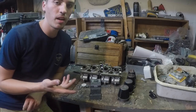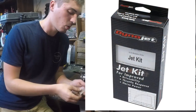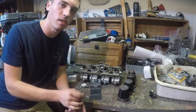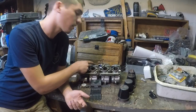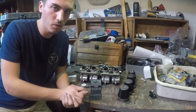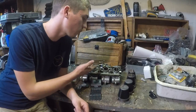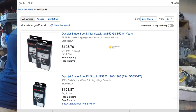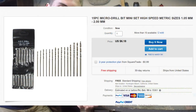There are two ways to jet a carburetor: you can buy an actual jet kit online, which comes with bigger jets, maybe a bigger pilot jet, some springs, possibly some drill bits, and instructions. Those can be nice if it's your first time. I've done it both ways, and in my experience it's much easier to just drill out your main jets to make them bigger, and it costs a whole lot less — I got this drill bit set for maybe five bucks.